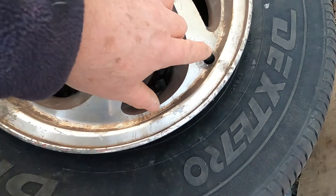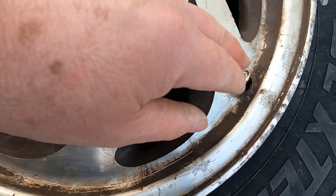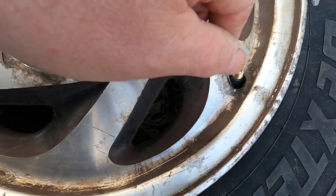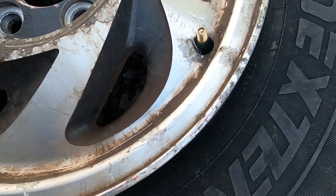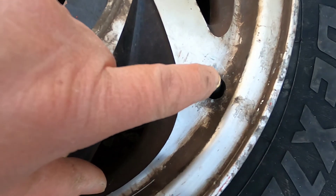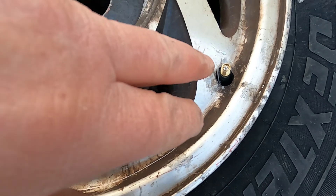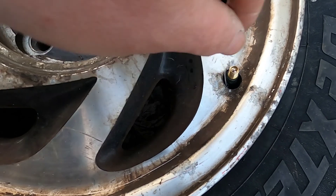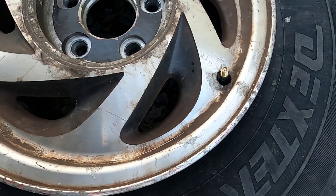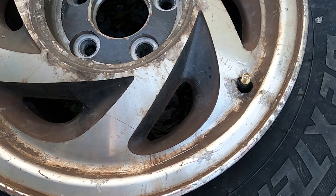Note of caution: when I was filling this up, the old one — checked with the tire gauge — it was only at 30 pounds of pressure. I put more air in it, checked it again, it was at 33. This tire calls for 44 pounds of pressure. I never seen it happen before, but the valve and the whole inside just shot right out, and it was at low pressure. So if you're filling this up and working on these, don't stand directly in front of it — stand off to the side. Been playing with tires for years, I never seen it happen, but it only takes that one time.